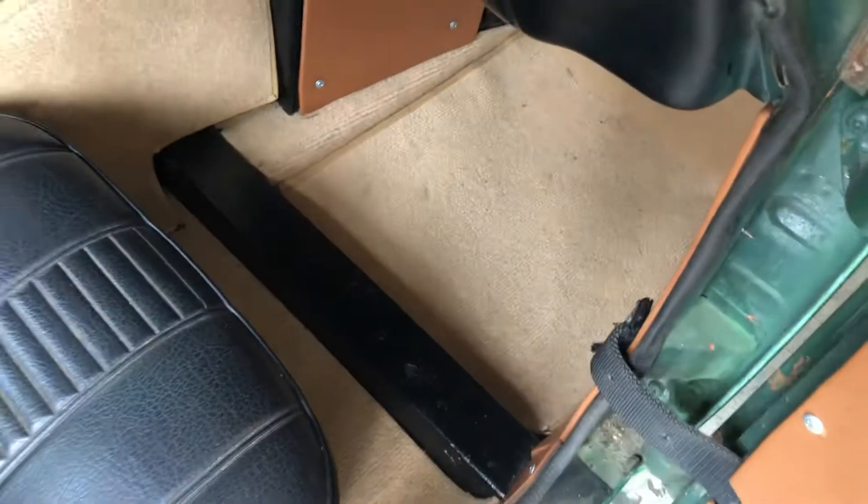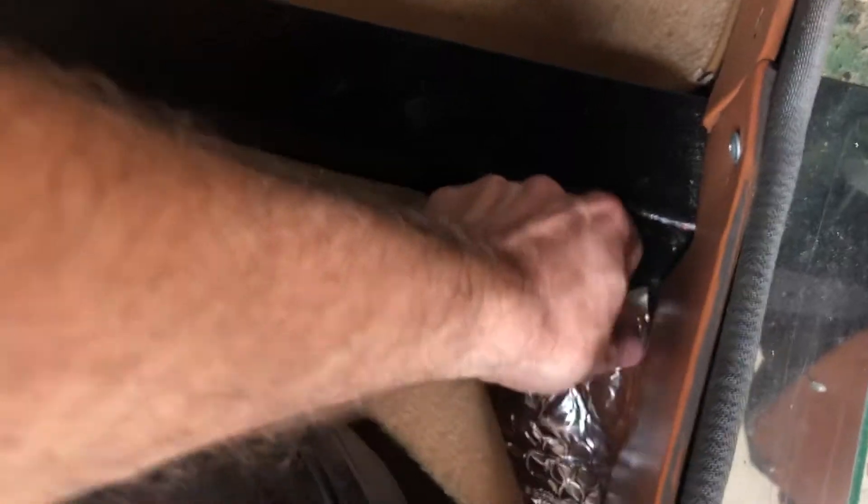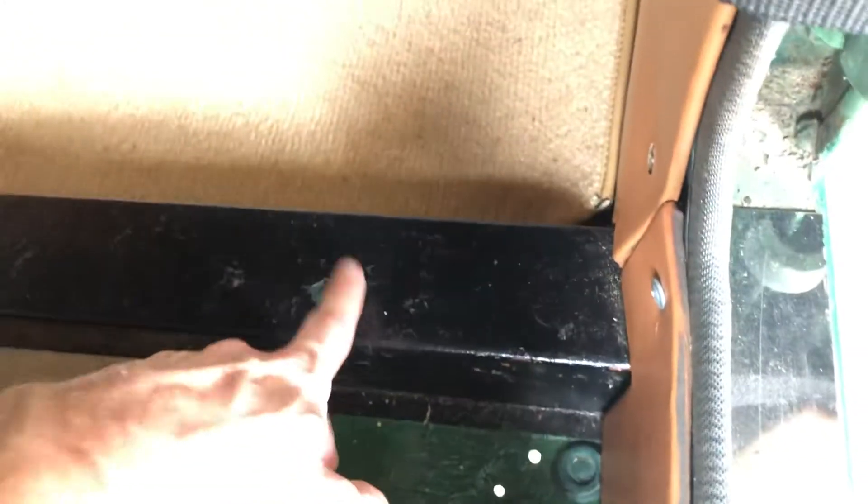I've been underneath the car and in the floorboards and everything is solid. I'll show you a little bit in here — I put a new carpet kit inside. Passenger seat is in great shape. I do have the headrests but they're tan so I didn't put them in. Under here I put heat shielding throughout the underneath, and the tunnel and back area are heat shielded and sound shielded — it actually made a big difference in noise and the drive. Pulling up the carpet you can see underneath — it's all painted green with rust preventative. The floors are very solid, this beam is in good shape.